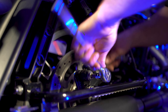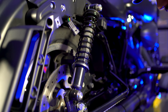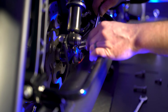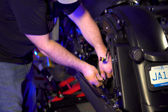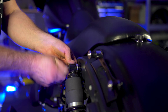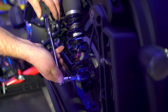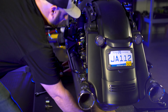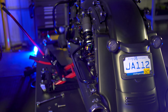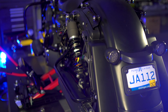When you're tightening these up at first, don't go real super tight — you want to make these kind of hand tight. What you want to do is tighten them up once we drop it back down to the ground. Just snug these until you drop the bike back down.